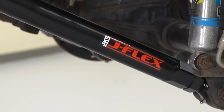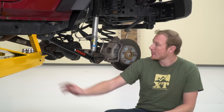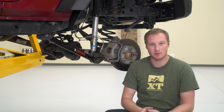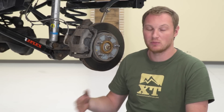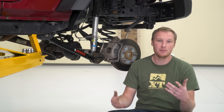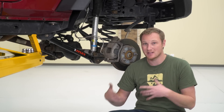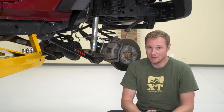The last reason a new control arm is going to be a benefit is additional articulation. Up here on this end of the control arm, you're going to have a factory-style rubber bushing, but down on this side, you're going to have a heim-style bushing, and that's going to allow for a ton of articulation, a lot less binding, really independent movement of one side of the axle from the other, giving you the ability to roll over very large obstacles while keeping as much weight on as many of the tires as possible, giving you the maximum amount of traction.